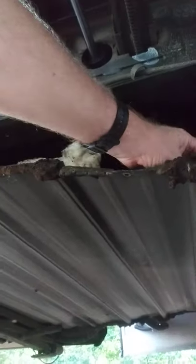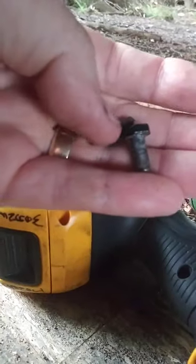I got to thinking about what could be the problem. It was obvious the motor was working. Our camper has the Arctic pack, which has sheets of metal across the bottom. I took several screws out to drop the panel down right under where the ram is, and when I pulled it down, I found pieces of a bolt that was broken clean in half laying on the insulation.